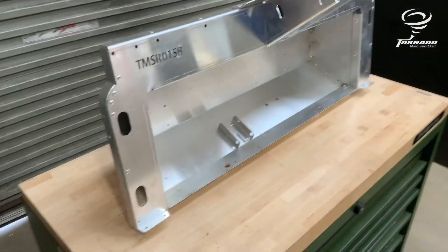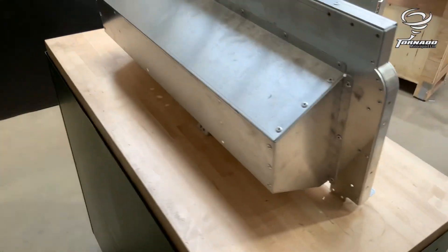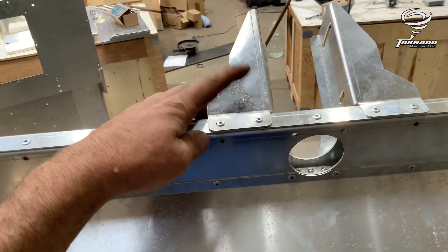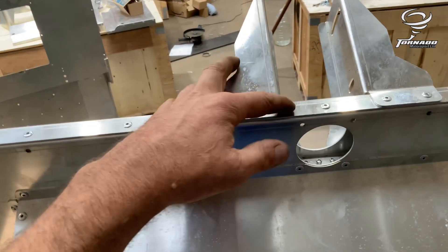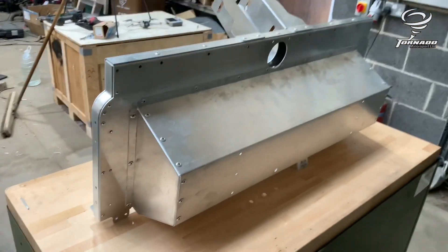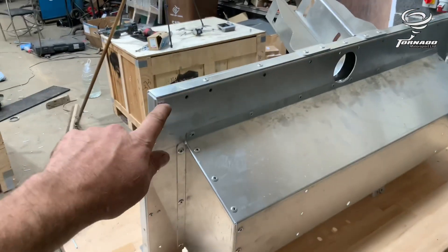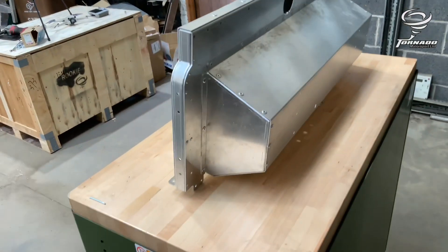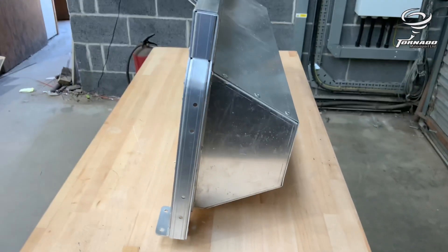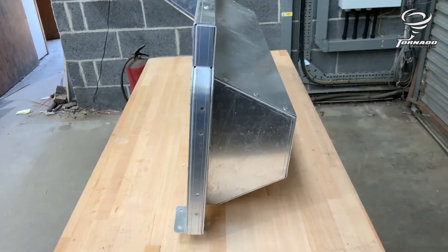You've got your steering column brackets that fasten on here, and obviously the front is the footwell. This hole for some reason is missing — you just have to drill it. It's on this part but not on the bulkhead, so just fasten the rest up and run your drill through there. Later cars will be edited but just for now it's like that. Leave all the top row of holes out because your windscreen fastens there. Put the pillars on — if you follow the part numbers they'll be right, but make sure the holes are offset towards the front for the hinges.